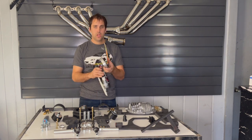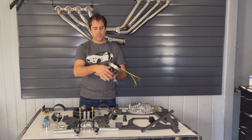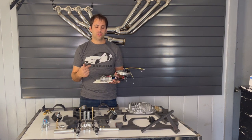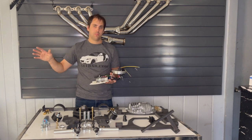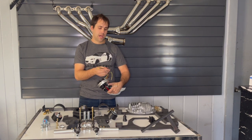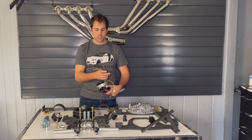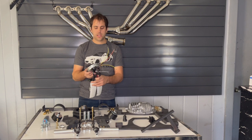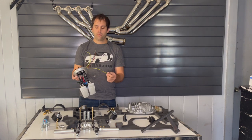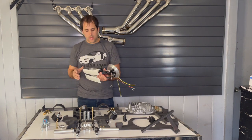These lines connect to your factory fuel level sensor so it continues to work. This hose is where you snip your original saddle tank fuel hose and connect it to pick up fuel from the passenger side. You will need to wire this into relays — I don't have a relay kit for this, but there's a power and ground wire for each pump. I ran both of mine all the time. The two significantly smaller wires run your fuel level sensor; orientation doesn't matter as it's just an ohms reading.